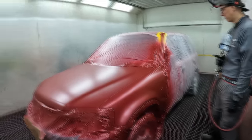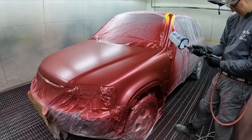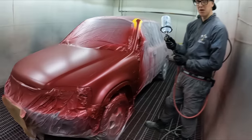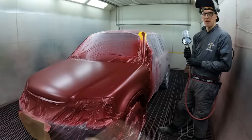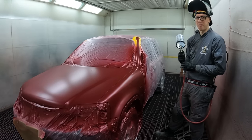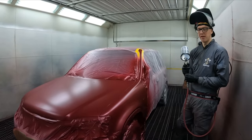Yeah, no worries. We just ended up having to give it a bake because the base coat was still a little bit sticky because we had to put so many coats on. You know what PPG's like, it doesn't cover. And just go ultra skinny, as skinny as you can on the first coat. What I've been doing is going really skinny but close so you can't see any base coat, then one coat and straight back around and put your second coat on straight away.